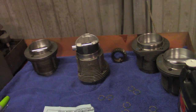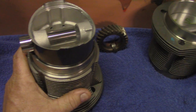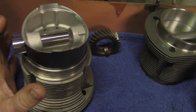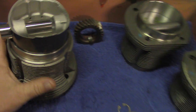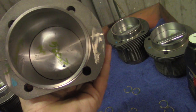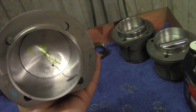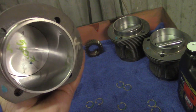Another thing I wanted to go over: when you do your pistons, you take them apart, you've got to clean them because they have cosmoline in the ring grooves and the rings are never positioned in the right position. On an air-cooled motor, you always want to lay them out — number the cylinders, put your pins in there, put your arrows the right way — and everything will go really quickly.